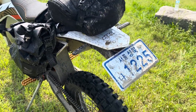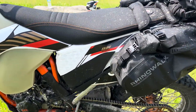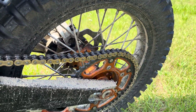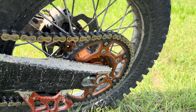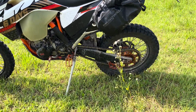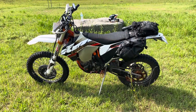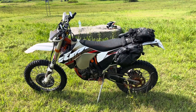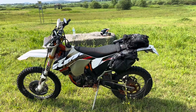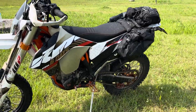The rear has LED blinkers. I believe this is the stock gearing: 14-tooth countershaft sprocket and 50-tooth rear — that's the KTM aluminum and steel dual sprocket. So it's 14/50 gearing, which works pretty well. I cruise at around 110–120 kilometers an hour on the road, which is about 70–75 mph. I'm not on this bike to go super fast on the road anyway.